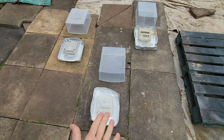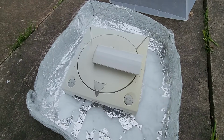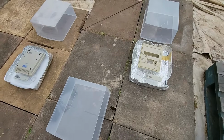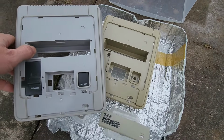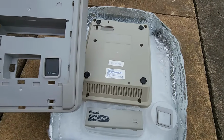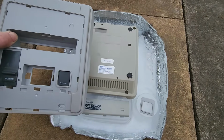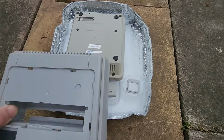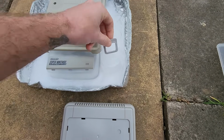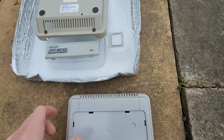So we're pretty much left with the H₂O₂ solution, which as expected didn't really make any progression in the de-yellowing of these items right here, which is to be expected. But this one right here is showing a lot of promise. This is the 12% H₂O₂ solution, quite a lot of it. We can see the little buttons around here is almost level with our control. It's almost there.